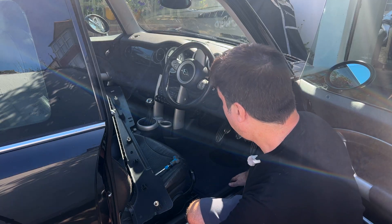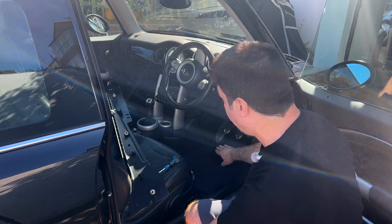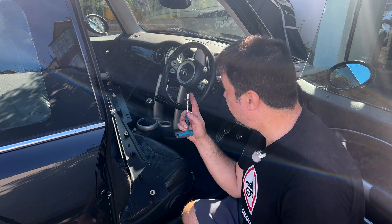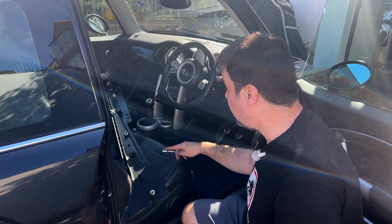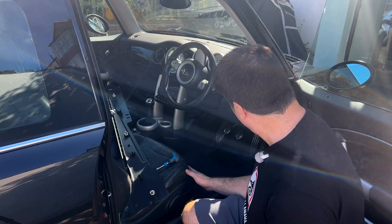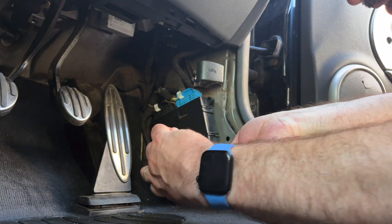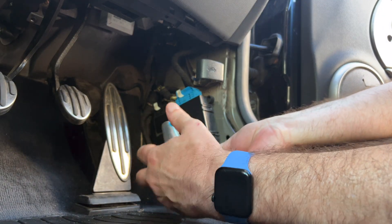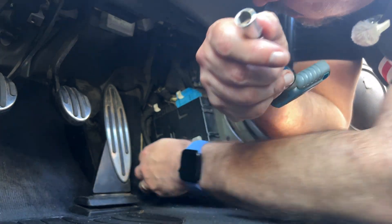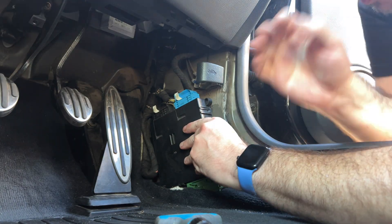To do that you have to remove this piece of plastic trim - I've actually already removed it, but you can do it by just peeling it off to one side. I wanted good access to get to the old BCM. From what I understand it should just be a case of 10mm bolts, unclip, and then we're done in theory. From what I've read online I don't even need to worry about turning the battery off, which is quite nice. So that's the two 10mm bolts off - one there and one just behind.